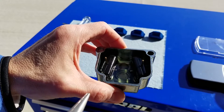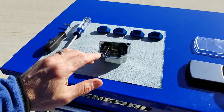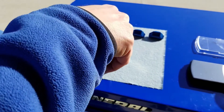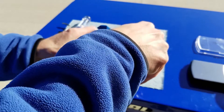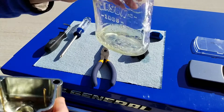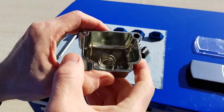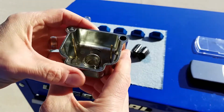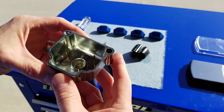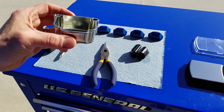With the bowl removed, the first thing we want to look for are our floats. The pins on the side of them are below the surface of the fuel — they should be at the level of the fuel in the bowl, which is a sign they're heavy. We'll pop them out and take a look at the bowl. First, get rid of the fuel. We want to ensure that the bottom of the bowl is nice and clean. This is a casting, so it can develop a white corrosion or there could be debris from the fuel system — rubber fuel hoses degrade, and there are many sources of possible particulate or contamination. That's a good clean bowl — that's what we want to see.